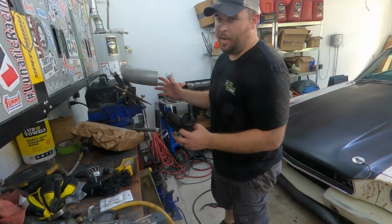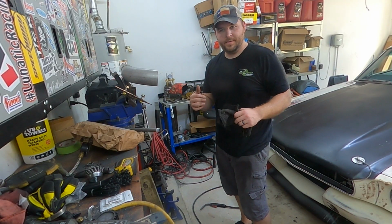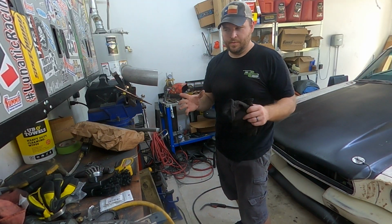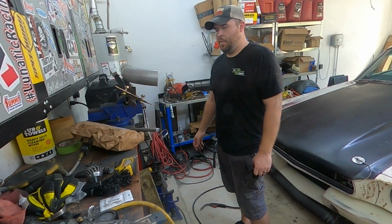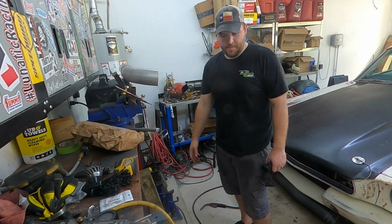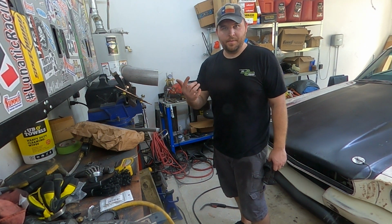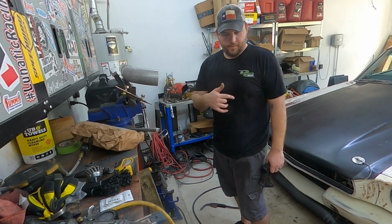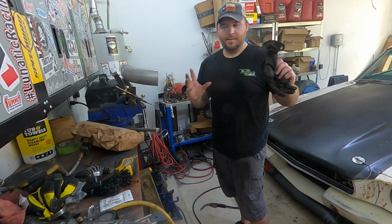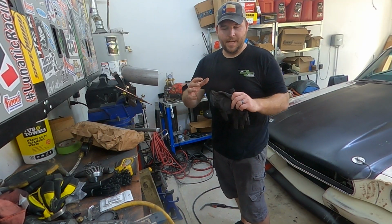I'm just gonna go ahead and weld these 90 pieces together, and the straight runs that basically meet from muffler to the outside of the car. I'm gonna go ahead and weld those sections up. That way we just have the one weld to go here. And matter of fact, now that I think about it, I could probably make that weld and then just get the other piece of pipe from underneath the car and just make the weld, because it's just an L piece. And we're not welding it onto the H pipe. We're just going to use that clamp so we could rotate it.